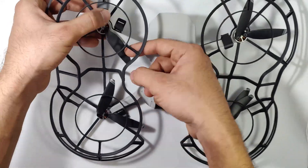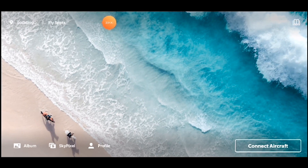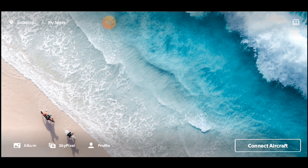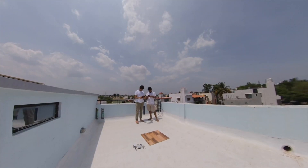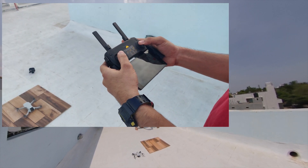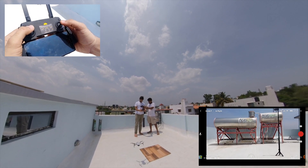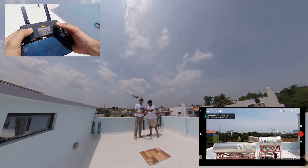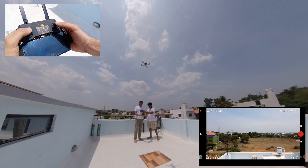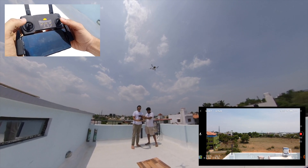Now we've understood how to set up the drone — let's go out and check. Before you go out, install the DJI Fly app and log in. This is how the app looks. Turn on the drone and controller and click on 'Connect to Aircraft.' On the top left of the app you can see the takeoff indicator — green means ready for takeoff. To take off, move both sticks inward. I've set the stick configuration to Mode 2. Move the left stick up to ascend and down to descend. Before flying high, always make sure the top right shows a proper GPS lock.